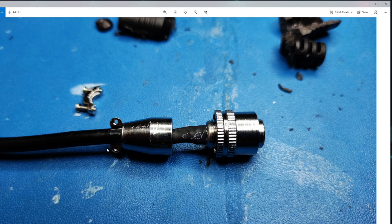Once the plastic cover is completely removed, you need to take out two screws that are holding the clamp on. Once you get the clamp off, you need to grip this end part here because this part will rotate - it's a rotating part. Grip it using pliers very carefully so as not to squish it, and then rotate this section because you can see the threads where it's actually screwed off. So that was getting the plastic shroud off, then the cable relief clamp, and then screwing it back to get access to the goodies below.